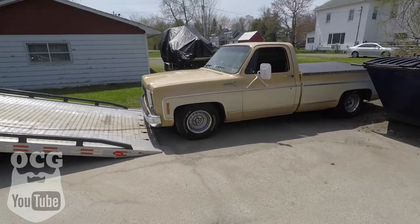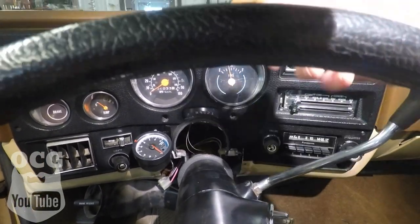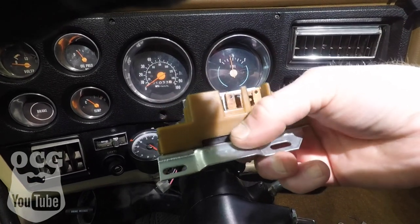I don't even know where we are in this video — going back and forth between air conditioning, truck not starting, and getting towed. I've got the steering column down and I've removed the ignition switch. I tried starting it with a screwdriver pulling on the switch and it still doesn't start. So there are two things we could be dealing with: the ignition switch itself — they didn't have one in town so I ordered one for tomorrow — or if it still doesn't start after that, we could be looking at a starter or solenoid problem. The lowered truck makes it hard to get underneath, but tomorrow we can jack it up and get at the starter if needed.